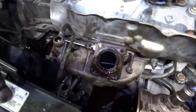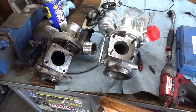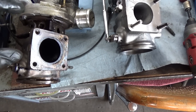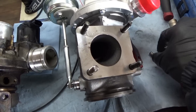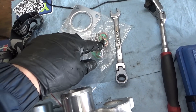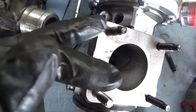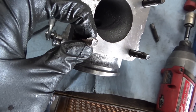We're just going to put everything back together with fresh gaskets, fill it up with fluids. It's going to be fun to start this thing up. Time to install the new turbocharger. I transferred most of the studs to the new one except for this one — the threads got messed up. The aftermarket kit comes with replacement studs, but I prefer to reuse the originals because they look a little beefier and they have this hex for easy installation.